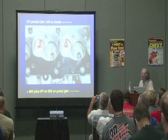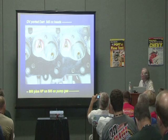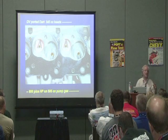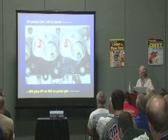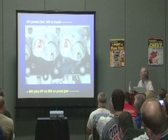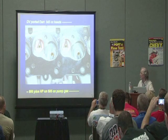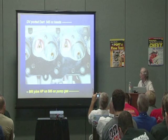This is what I usually work on — a typical hand-ported 345 on a 505. That's not the big-bore big block, but a four-and-a-quarter bore, 60 over. You can reasonably expect, if you get everything right — intake, manifold, exhaust, cam — to see 800-plus horsepower from hand-ported heads.